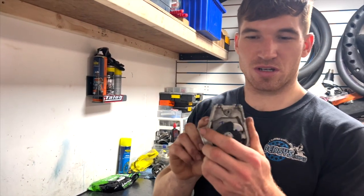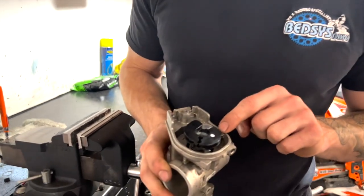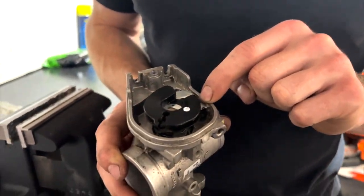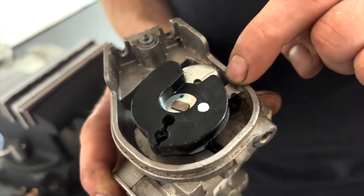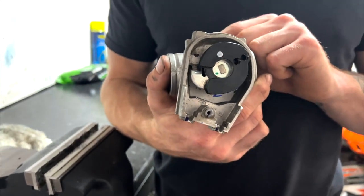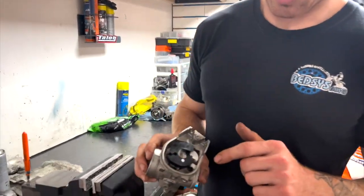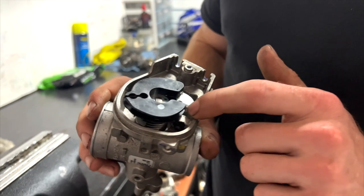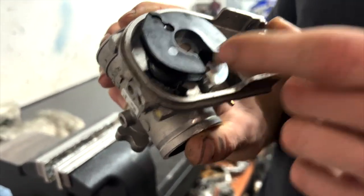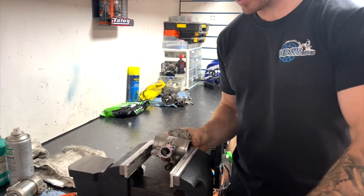We've just took the throttle body off, because now we're going to do the idle screw mod. There's a little screw that's in here. It is Loctited in, so you have to heat it up to actually get it out. Get a little 4mm Allen key going through there. I think it's 4mm. 4 or 3. Can't remember now off the top of my head. So we'll get some heat on it. And yeah, get that idle adjustment.